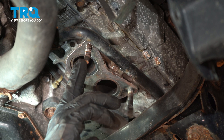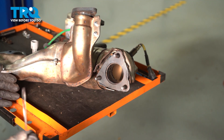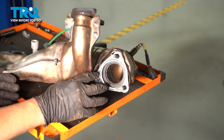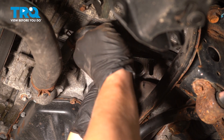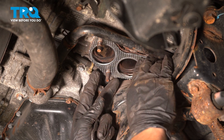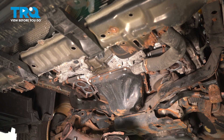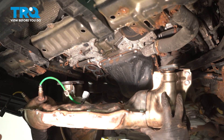And if you had them come off on the other side, go ahead and install those now too. Now that your manifold is ready to go up, go ahead and slap your gasket on here and put your gaskets up. And then do the same thing to the other side. Now that your gaskets are on, go ahead and put your exhaust manifold in.